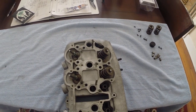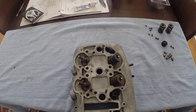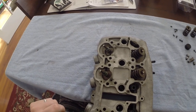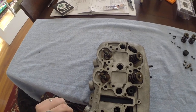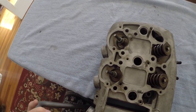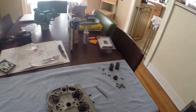And you go ahead and start the compression here. I like to do it from underneath the actual spinning part because it doesn't put any force this way, which will spin it off center of the hat at the top of the valve spring. So I think I've compressed it adequately.